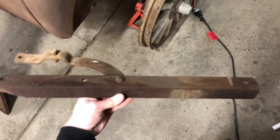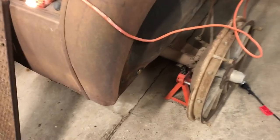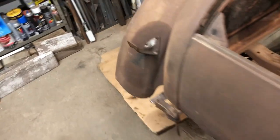Before you take the rear fender off you have to get to these two bolts, but in order to get to those you have to take off this bumper bracket. All those bolts were stuck so I had to use the air ratchet to get it off. There are two long bolts and two short ones here, another long one here, and it was bolted in down there and came right out. Now I'm going to start the same thing on the driver's side.